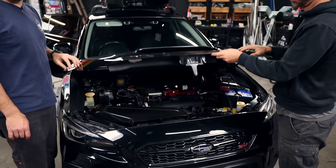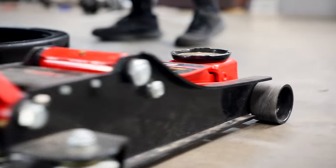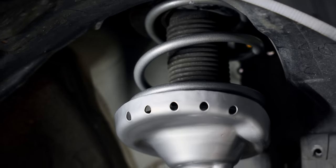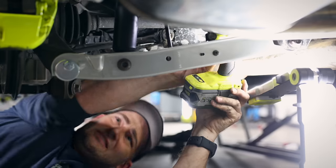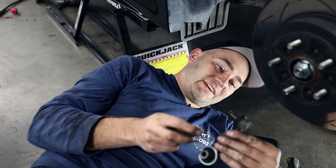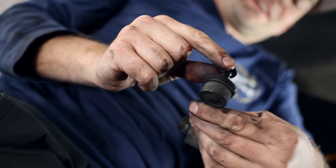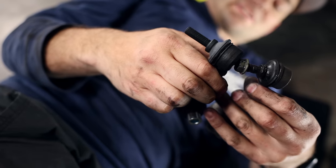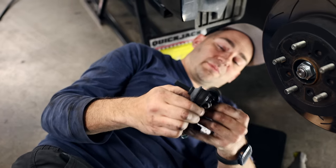It was in so many pieces but now it's done - it looks really neat and awesome. I can't actually start it yet because I've got a load of tune to put on it, but once I've done that we can start it. The old sway bar links off the 2018 STI were crusty, wouldn't come off, leaking grease, and completely worn out. I'm upgrading them to Whiteline adjustable sway bar links, which means we can fine tune the way it works. It's a nice upgrade and gets rid of that chattiness - just make them the same length, drop them in, and it's done.